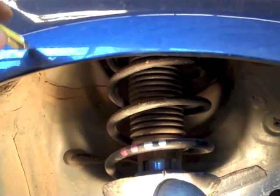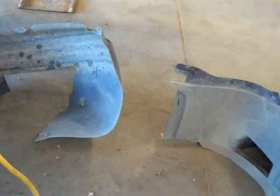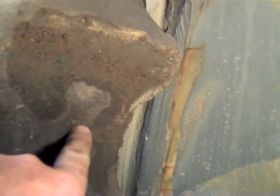I didn't think I had to do the front fenders, but I tried a magnet on them and, yep, they are steel. So I took out the shrouds — the inner wheel well shrouds. When I look up inside I see there's this foamy stuff, sort of a rubber. You just pull that out. In behind there's a plastic shroud, and I unbolted that. There you can see there's all kinds of tin up in there that you should undercoat.